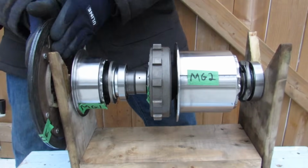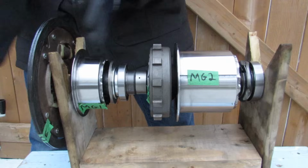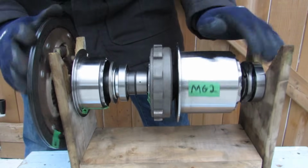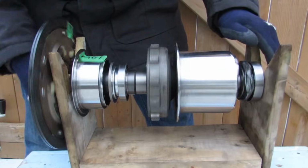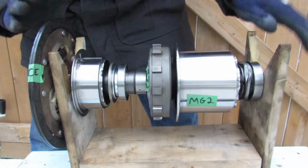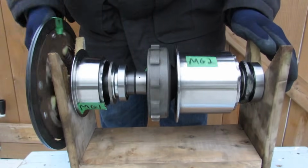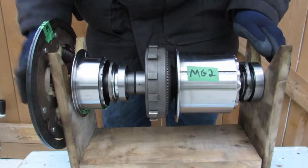And now, because the engine only works between 1000 and 4500 RPM, there's no clutch mechanism like in a manual transmission or a torque converter mechanism like in an automatic transmission. So you're just suddenly going to start turning at 1000 RPM, and you're going to have a really jerky reaction as the vehicle begins to turn, because MG2 does not have anything powering it to slowly start turning. It's just going to instantly engage. Now, in addition, since you don't have anything powering these motors, you're just going to be relying on the 76 horsepower 1.5 liter engine alone, which is going to be pretty slow overall, but it'll get you home eventually.